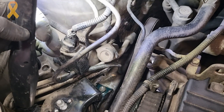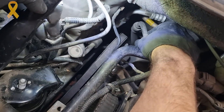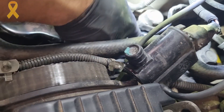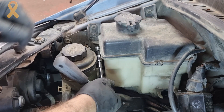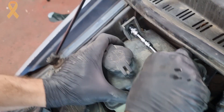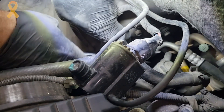We have one more belt to go — the power steering pump belt. The access is not the most convenient, so to make life easier we will first remove the emergency switch of the fuel pump. Pay attention that if it is pressed by mistake, the car may not start after — and this is what happened to us. I also removed the washer reservoir, which is connected with several bolts with 10mm heads, and moved the steering pump oil reservoir slightly to the side.